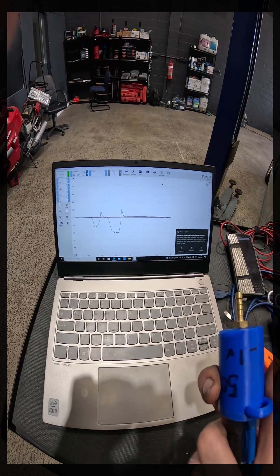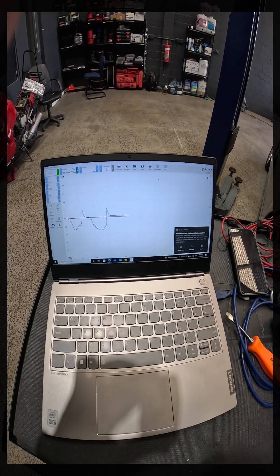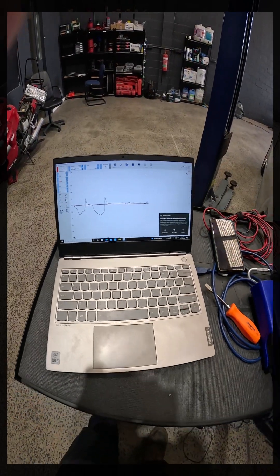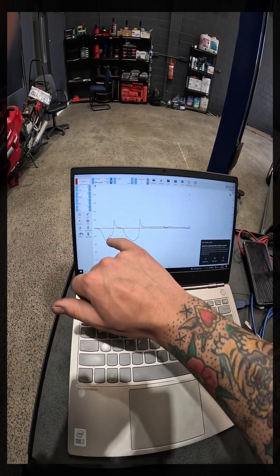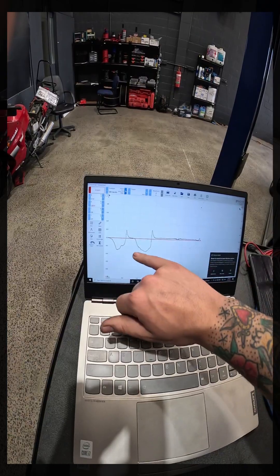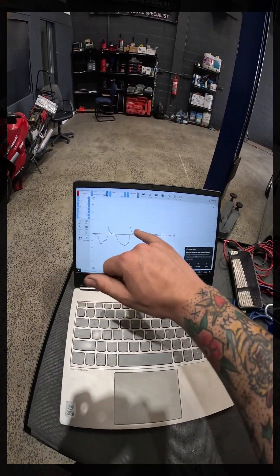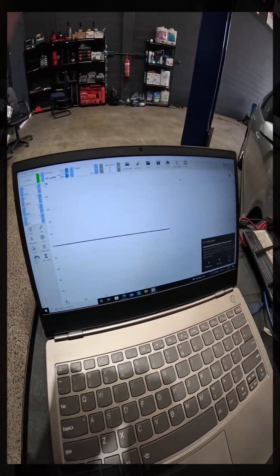You can see there — if I blow into this pressure pulse sensor, you don't have a set reading. If I pause that, you have what's basically called a slingshot effect. So when there's pressure going into the sensor, you can see it's going down, and then that is the slingshot effect of that piezo, and that tapers off into a flat line, a zero volt reading.